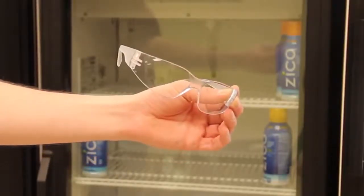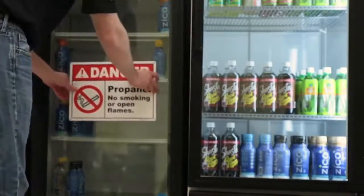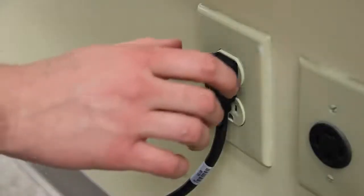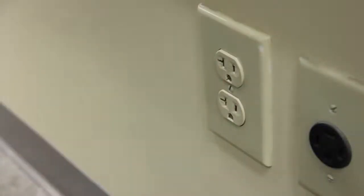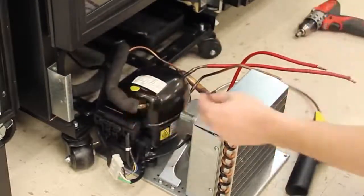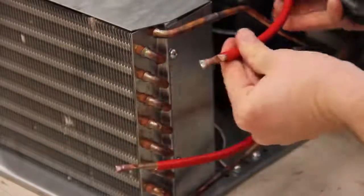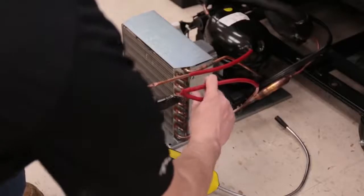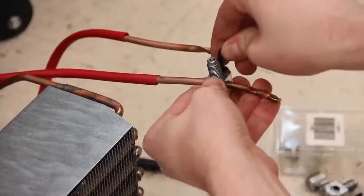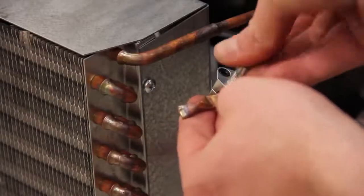Put on your safety glasses. The technician should then display the safety placard in the area where the repair will be made. Disconnect the unit you are repairing from any power source. The service technician will then need to install temporary piercing valves to allow access to the refrigeration system. To do this, you may need to trim a portion of the required red identifying sleeves back and place the temporary valves as close to the crimp on the end of the process tube as possible. The combustible gas leak detector may go off during this process. Once the high-pitched beeping levels off, you can proceed.